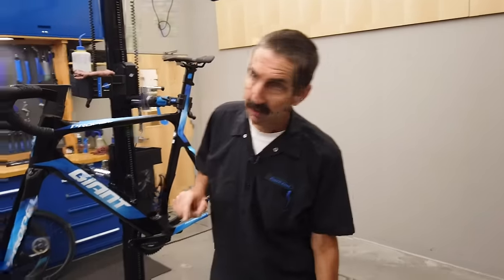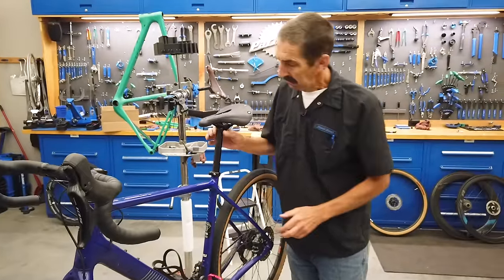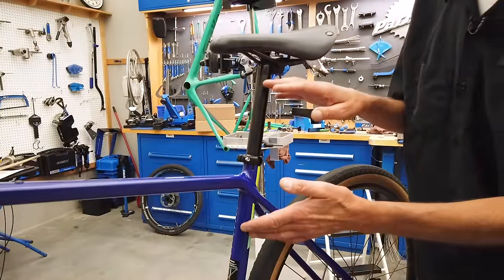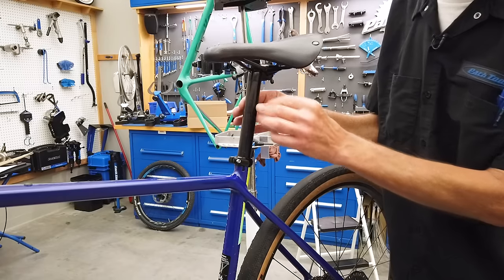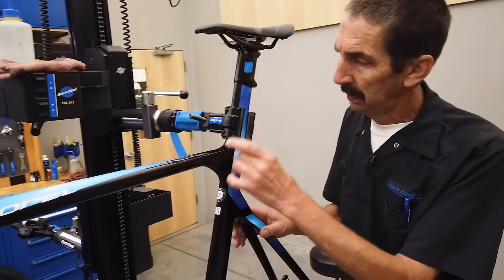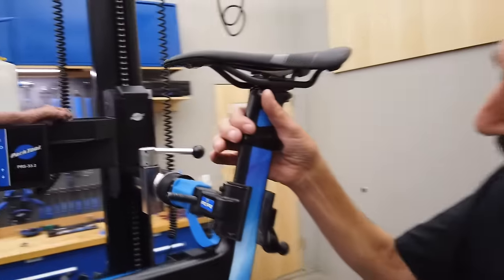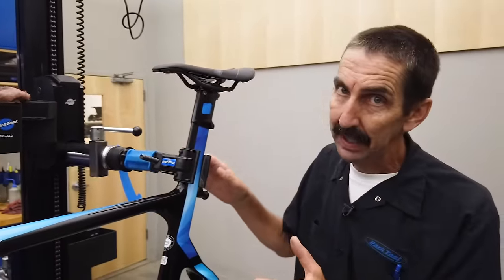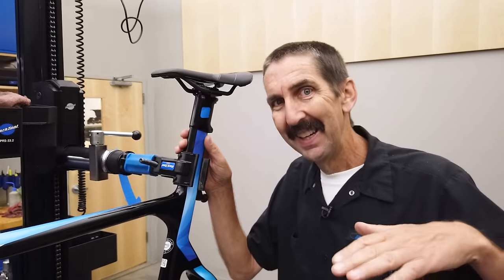Let's look at some of the old systems on this bike — carbon, sure, a clamp here, it works. The post goes up and down — pretty common, we've all seen this. You could eliminate a lot of material here if you extend the frame up and have the adjustment at the top. That's what some bikes have done — frame all the way up, the seat is here, so this collar goes around it. It's not inside and wedging, it's going around it — that's why it's stiffer, more rigid, and lighter. The downside: if you want to loan it to a friend who's a different leg length, there's not a lot of wiggle room.